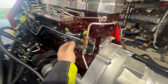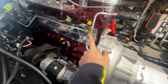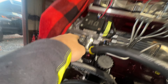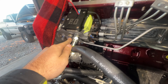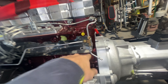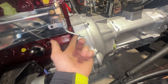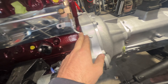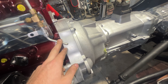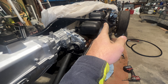The T-fitting right here — we'll thread that on there and get this one threaded on there too, see exactly where everything sits, tighten it down. I believe at that point we've got a fully routed fuel system in terms of fuel supply to our VP, fuel supply to our injector lines to our injectors, and then our return. We just have to figure out how we're going to route everything back to the tank.